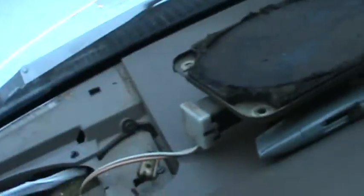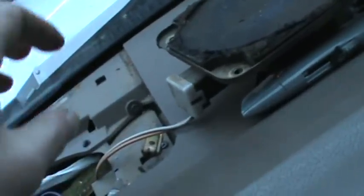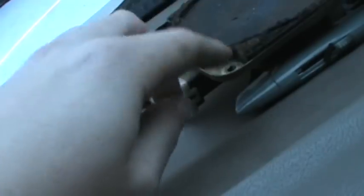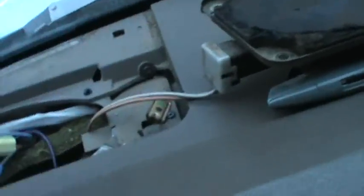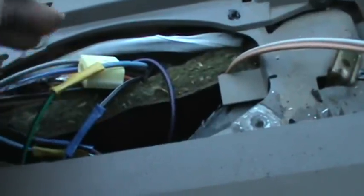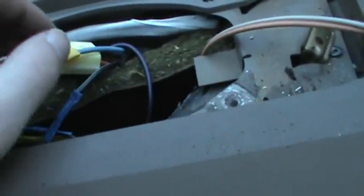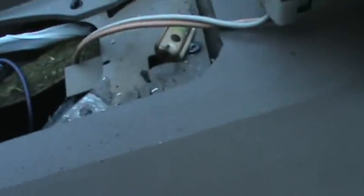If you look here, I had to access the wiring — I had to pull out the front left speaker. There's a grate that covers it that you just have to pop out; there are a few tabs, and then it's held in with four bolts. I just pulled that out and set it off to the side. This is the wiring for the power locks and for my power windows. It really helps to have a schematic of your vehicle. I have one of the Haynes manuals — those always have schematics in the back. That's a big help.